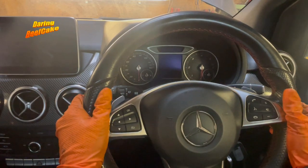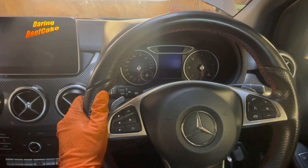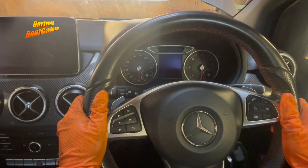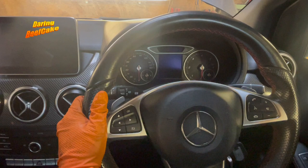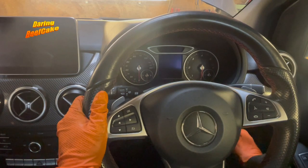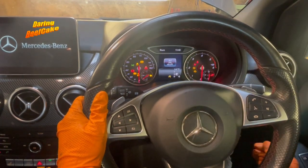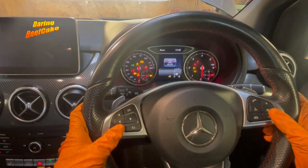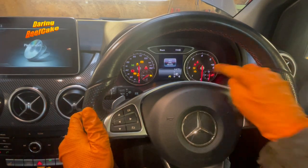Now I'm inside the car. What we need to do is release the rear brakes — the handbrake is an electronic brake. We need to do a little procedure to wind the electric motors back so we can push the pistons back. To do that, get your ignition on — just make sure you have the miles showing on the display, because if you have a different menu it sometimes doesn't work. Just have the miles showing there.